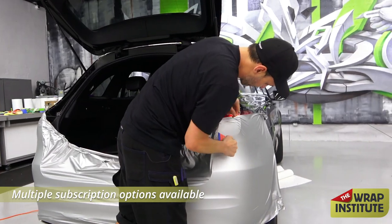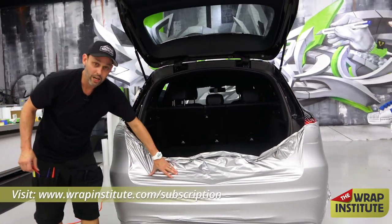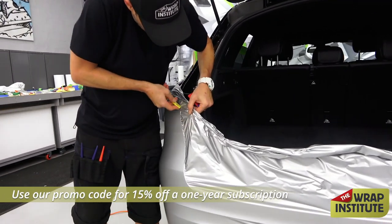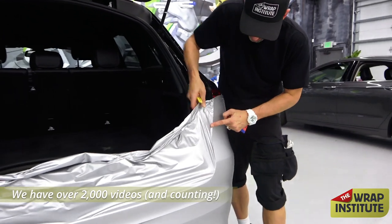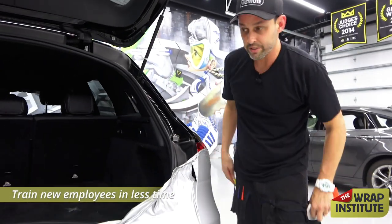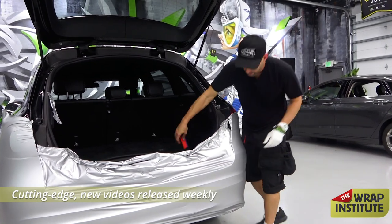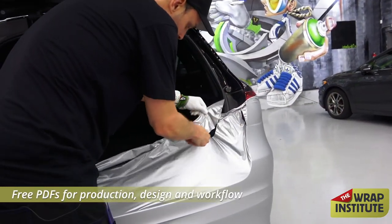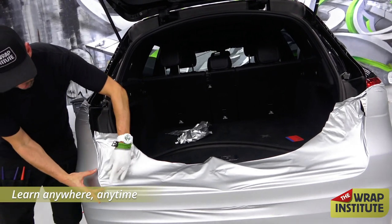The wrinkles are fed back to the top point. Look at this section — look how saggy it is — I've pretty much already wrapped the back bumper, tons of material right there. I make a relief cut high here, cut the material back a little bit and round it so it doesn't split, and do the same on the other side. Now the top parts are set. I trim back some excess material to give it a new shape — don't need all of that material — then it's ready to rock and roll.